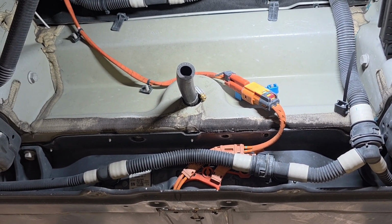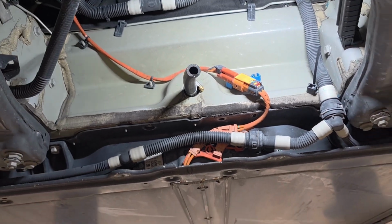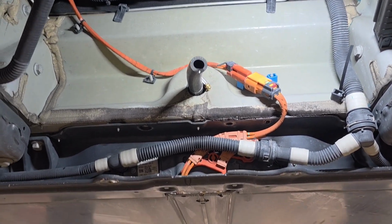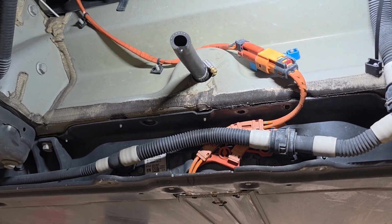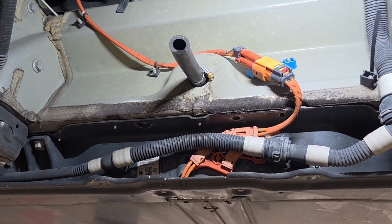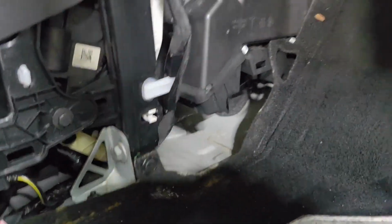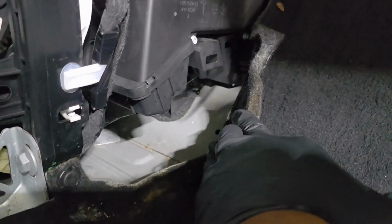So the good thing is, once I installed all this stuff, I put it in the air and I turned the AC on high and I watched the flow. And as you can see, it's flowing pretty good. And that means it's pretty much unclogged. And you might be saying, man, there's no way that this little drip can get a car wet. Yeah, it had it completely soaking. There was actually mold on the inside here. And I Googled how to get rid of mold, scrub with vinegar, and I scrubbed it, vacuumed it, scrubbed it, vacuumed, and I got rid of it.